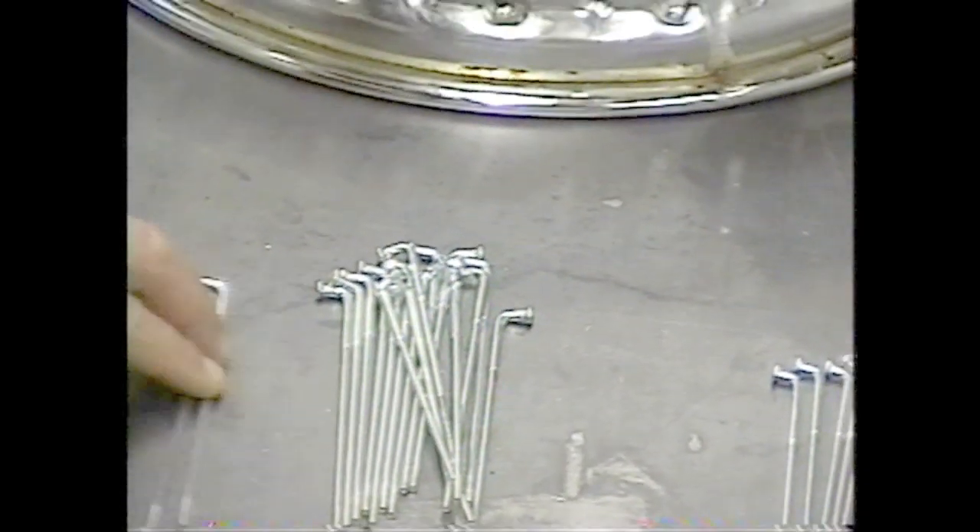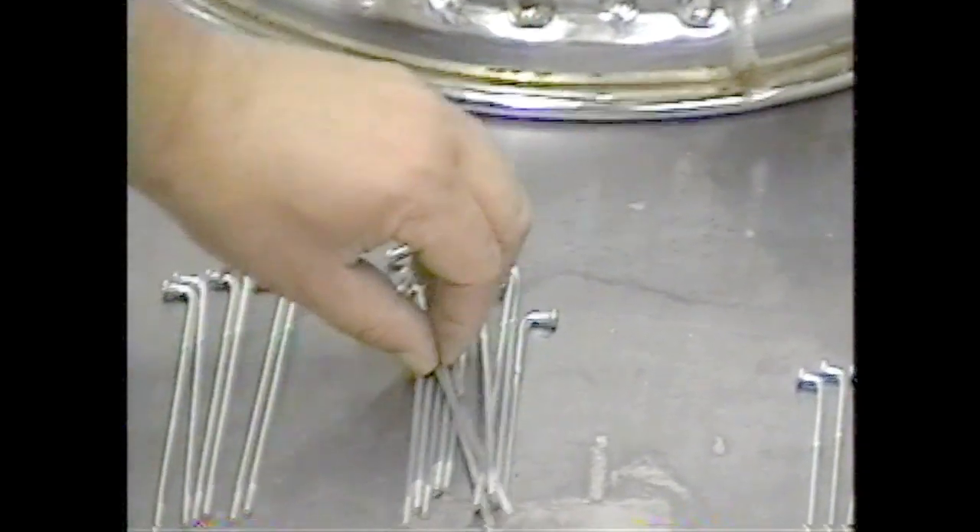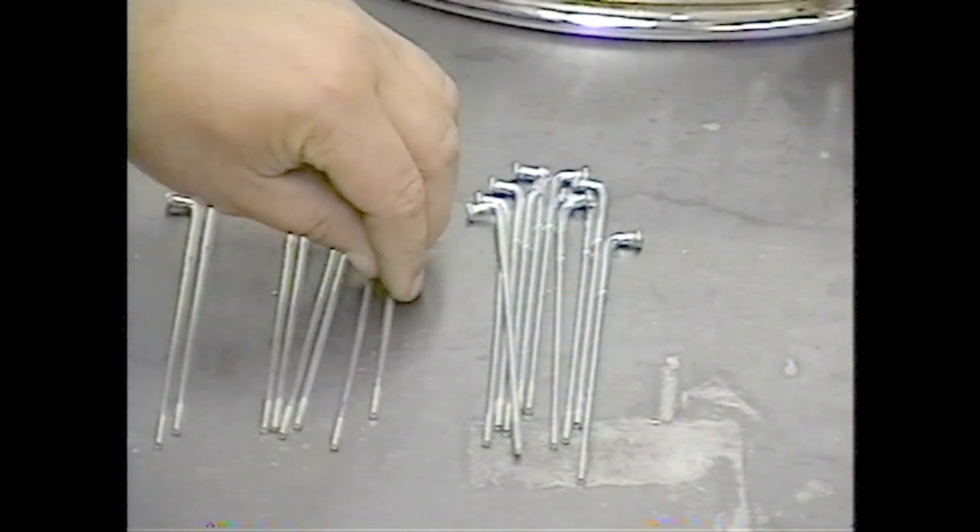Since this is a symmetrical hub with 36 spokes, half of the spokes — 18 — should be in one pile, and the other 18 in the other pile. The spoke on the right is an inner spoke. You'll notice that the angle here is less than 90 degrees, measured as if the spoke were to go straight up without bending over. The other spoke is 90 degrees or more and would be an outer spoke. This one is an inner spoke.